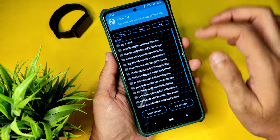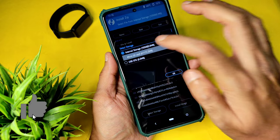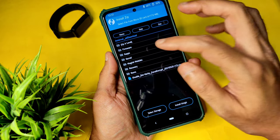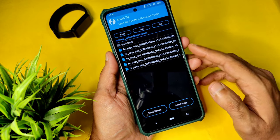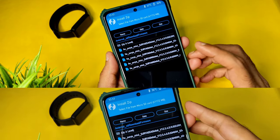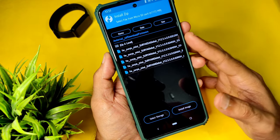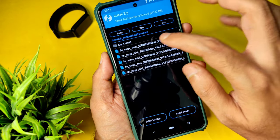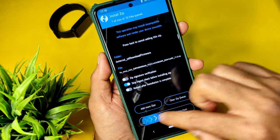Go to home and select install, select the micro SD card, and wherever you downloaded the files, select that. First, flash the firmware — here you need to flash EEA firmware. I just forgot to download 12.5.5 EEA global version, so I can flash this older Surya EEA global 12.5.4.